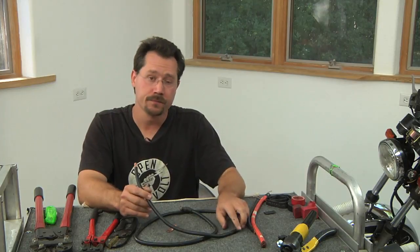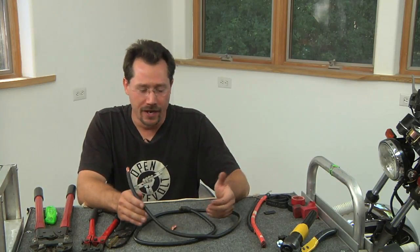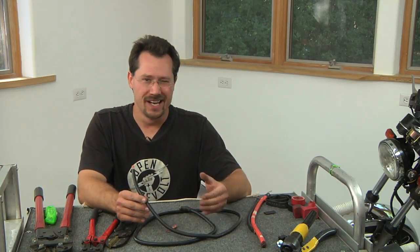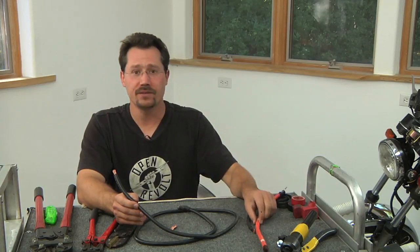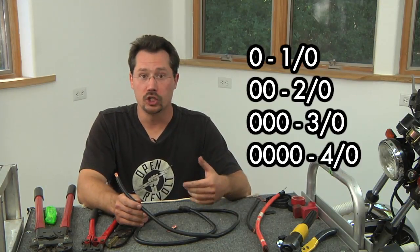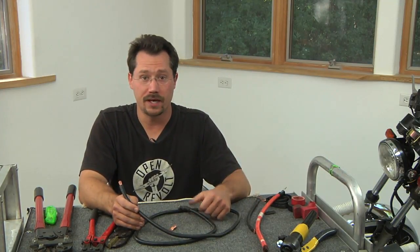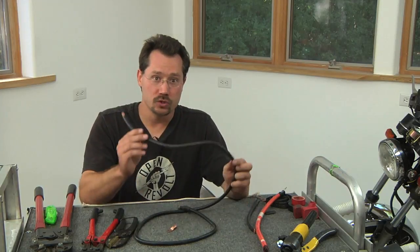We're going to be pulling a lot of amperage through the system to push you down the road on that motorcycle, so you're going to need some nice thick cable. In a nutshell, four gauge or thicker will work for you. Keep in mind that gauge is a weird way of measuring things — the bigger the number, the skinnier the wire. 16 gauge is pretty skinny, four gauge is pretty thick, one gauge is even thicker, and it goes down to zero, then double-zero, or two-ought. Four gauge will be great; two gauge is also fine, but at some point the cable gets expensive.